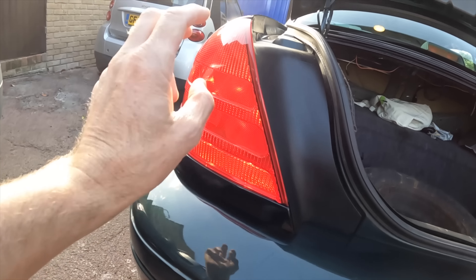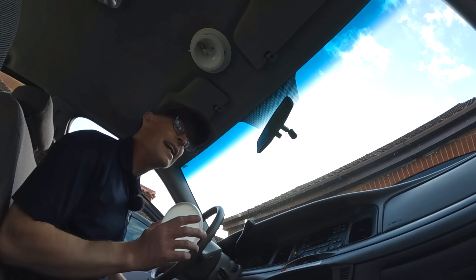So the other day I had an auto electrician come around. Sadly I missed him doing the work, so I don't know exactly what he did, but he used this feed box here and took a feed out of it to separate the indicators and the brake lights. Now, as you can see, tail lights and indicators are separate again — when we brake we're still indicating, and everything's hunky-dory. So if you're importing a Crown Vic or a Ford of a similar era, don't do what I did originally — take your indicator feed from this box hidden in the boot.